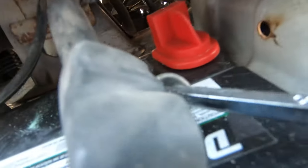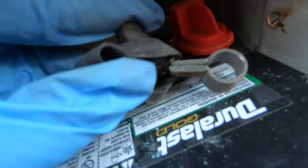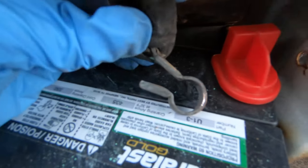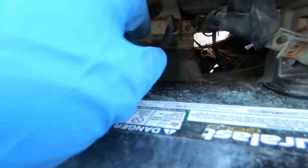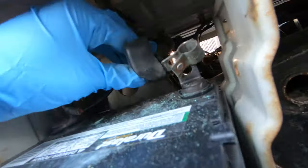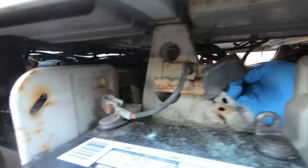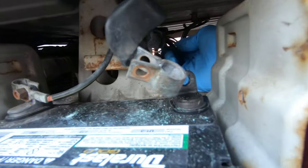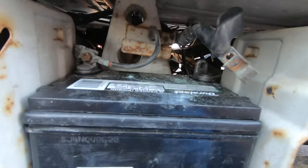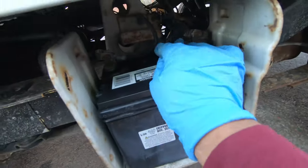I'm going to try to find tools I can bend this with - it should be really easy. First thing I did was take my screwdriver and put it in here, then separate the two terminals to get a little bit of space between them because they're basically stuck together. Pretty easy. This side is going to have to be a heavy bend. I'm going to push this in a little more - on the Hijet it might be different for different trucks - push it as far back as possible. New battery is in, nice and tight.